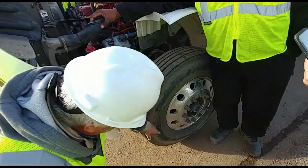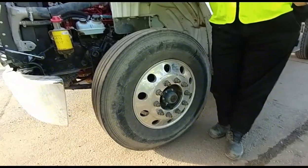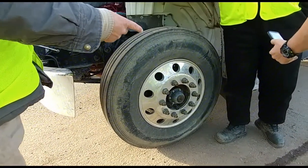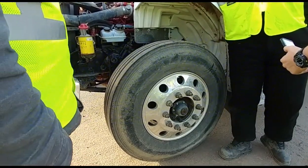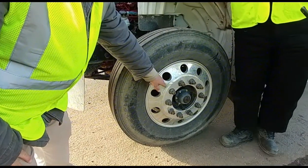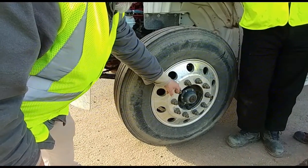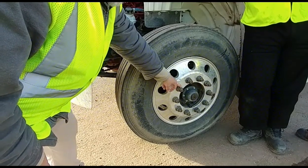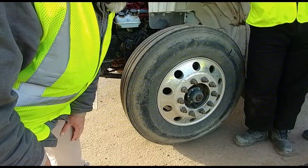And the P, I'm going to check my valve stem. I'm going to check the air pressure with a gauge. I'm also checking that valve stem to make sure there's a cap on it and it's not leaking. Check my rims. It's properly mounted. There are no illegal welds or cracks. Check my lugs. They're all tight. I'm checking for running rust or shiny metal, which indicate looseness. I'm checking my hub seal. It's properly mounted and it's not leaking.